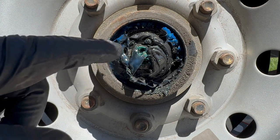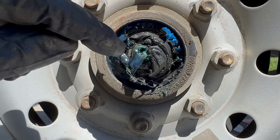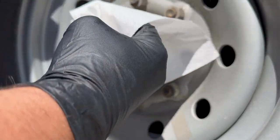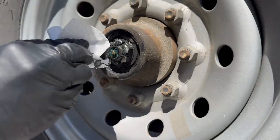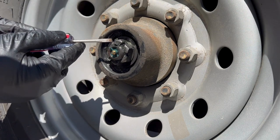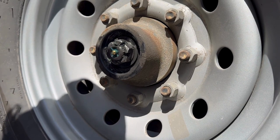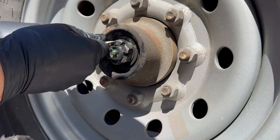I'm going to go ahead and clean this up so I can see the castle nut right here - just clean some of this grease off. I'll show you where the keeper pin is. Some of them will have a cotter pin, some will have a little flap that comes up and holds the nut in place. Right here is the little flap that goes up and holds this nut in place. You can see I can move this nut with my hand, and we don't want that. Same thing when I move this back and forth - there's a little bit of play there. So we're going to pull this flap down out of the way of this nut, and that will let us tighten this up.